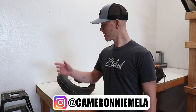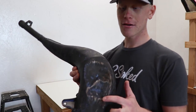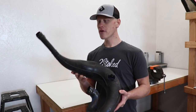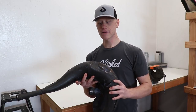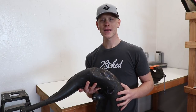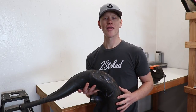What would you do about a dented pipe on a two-stroke? I've got this pipe for my CR250 — just a stock pipe that came with the bike, not the pipe I'll be using on the build. It's got some pretty gnarly dents in it, so I figured why not see what I can do. One option is a kit that plugs off the ends, then you add compressed air and heat around the dent and it pops out — but it's pretty sketchy if you don't know what you're doing. You can blow apart the pipe, do serious damage, and hurt yourself, so that's the last thing I want.